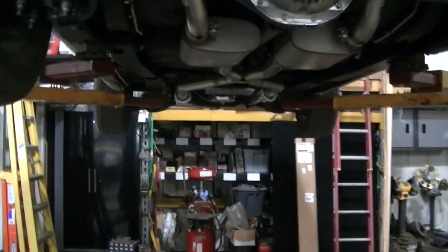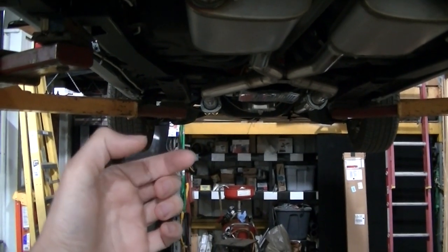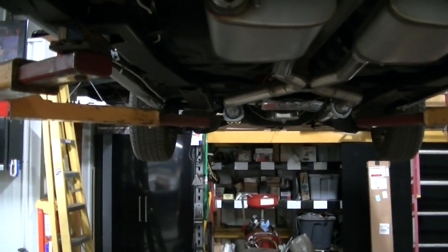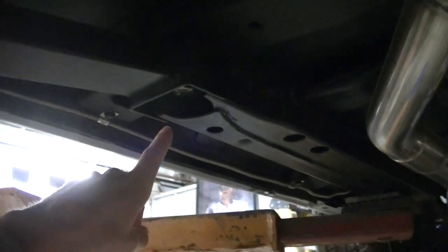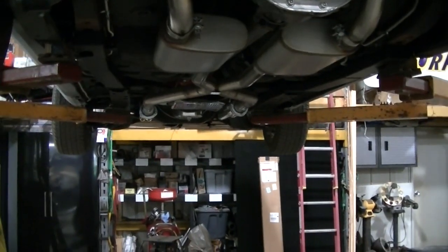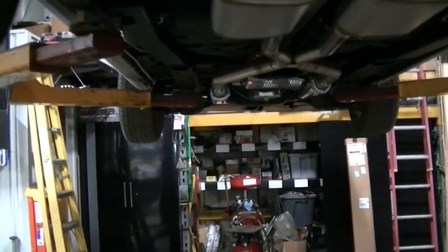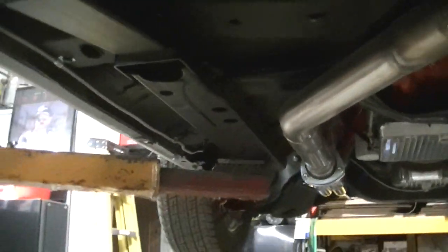But anyway, then we had a little bit of trouble getting it lined up. This side was off a little bit, and there's a nut in there. I guess what they call a cage nut, where it's a nut inside of a bracket that holds it from spinning, and that's what these big bolts go into. Had a little bit of trouble getting this one lined up. Had to drop the car down and move this flat washer up top, had to move it over a little bit because it wasn't allowing the bolt to line up. Now I've got all kinds of blurriness going on, but that was a little bit difficult. We had to kind of finagle that. I put the pry bar inside the frame and pried it down to get the bushings out.